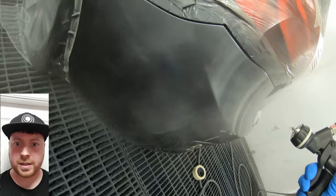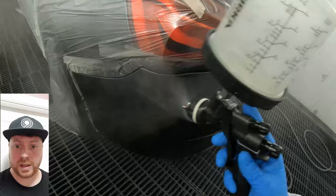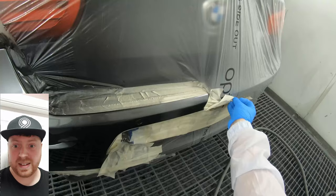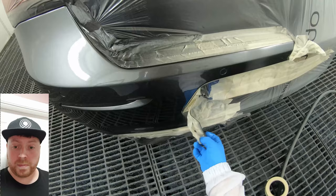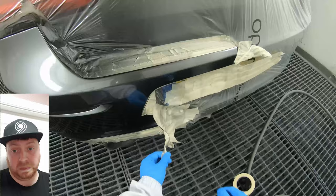It was at this point I realised I'd messed up. It was just after we baked the car — on certain angles you could see there was a slight halo around the primer area. So if you look closely when I'm leaning my head down you can actually see the primer edge. What we did was keep the car in the oven, give it a quick scotch over the primer area with the B39 again, and then re-cleared it. It's as simple as that. It's not fun to have a rework but it's just one of those things — I'll put it in the video and we can all have a laugh.